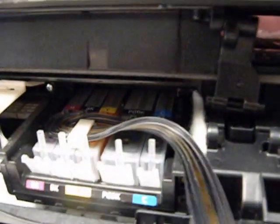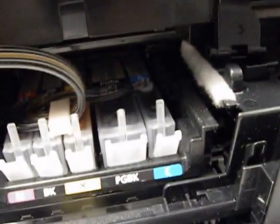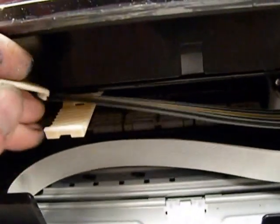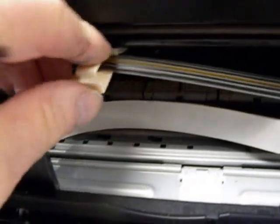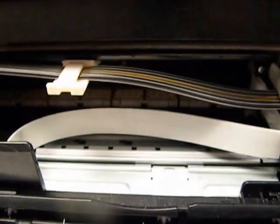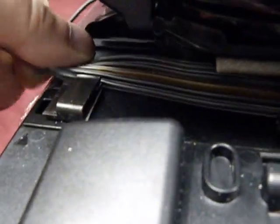Now we can turn the hose. If the hose is a little tangled, take your time and straighten it out. Make sure the hose isn't twisted. Now I'm going to push the cartridge — I'm going to hold the hose and push the cartridges all the way over to the right. That's going to give me the hose travel I'm looking for. So the next thing I'm going to do is put the little clip in here to hold that hose, snap it in. I'm looking for not too much slack here, and I'm going to slide it in the back. I put a little hose bracket here to give it guidance through there.